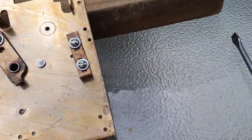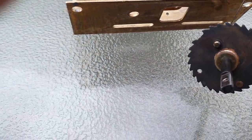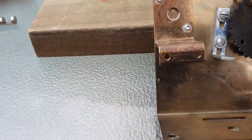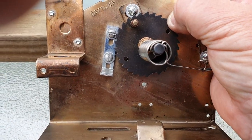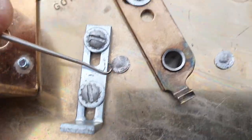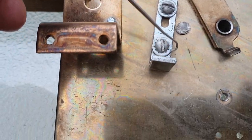This is the zero stop arm and that's the zero stop itself. On the back of the escapement wheel there is a pin, and that pin strikes the zero stop as a limit stop — it can't go any further, the pin is stopping it. We'll go through the adjustments of that again when we assemble it. We also have the drive arm upstop here — that's the thing that often breaks. Clearly this one has been replaced, as you can see by the different plating.